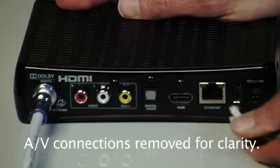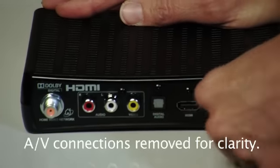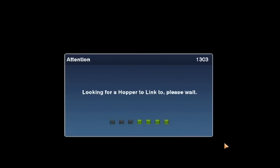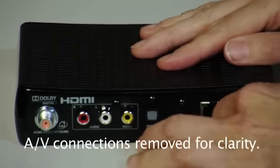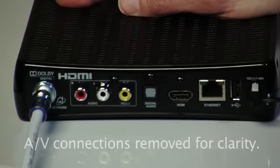With the Joey software now onboard the Hopper, we're going to continue working on the Joey. Unplug the Joey from power. Disconnect the home video network feed, then reconnect the Joey to power. When the Joey displays the 1303 pop-up, turn the Joey off with the front panel power button to put it into standby. Now unplug the Joey from power. Reconnect the home video network feed, then reconnect the Joey to power.